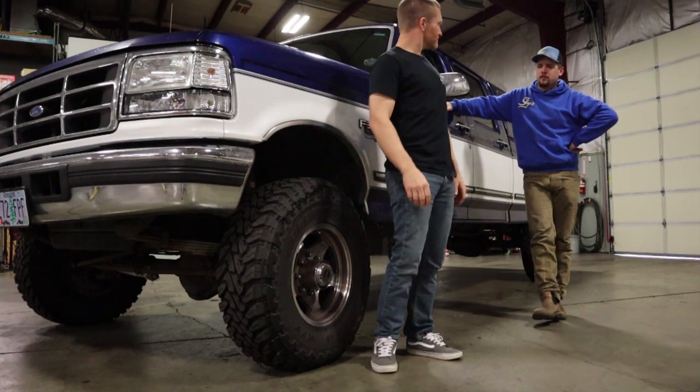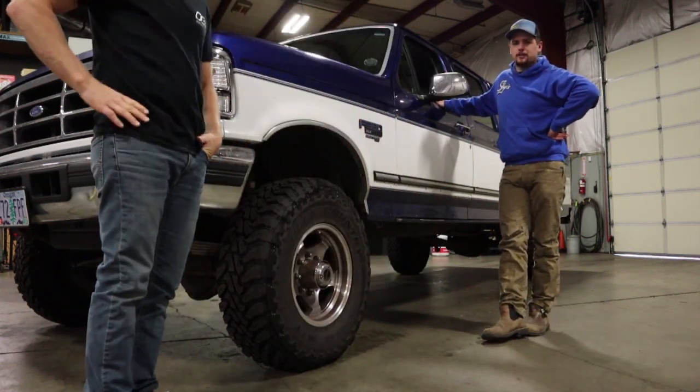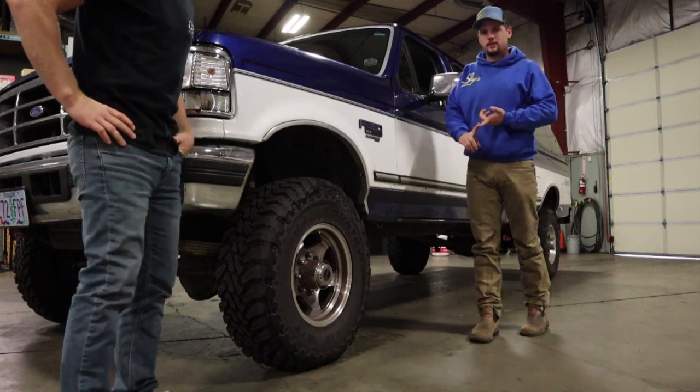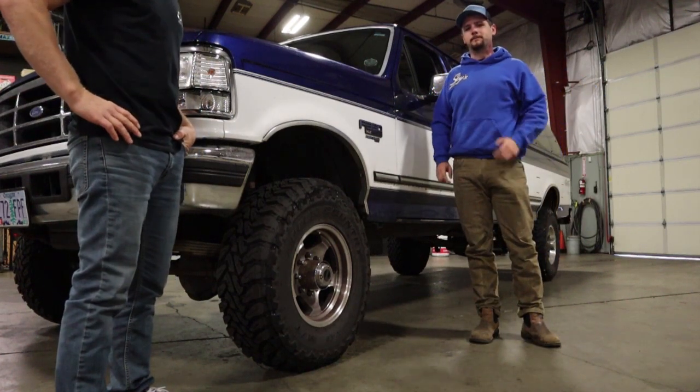Eric? Well, Devin gave me a call and said we wanted to lift this truck and correct some of the suspension geometry. So we're going to kill 3 birds with 1 stone. We're going to throw some crossover steering at it, crossover panhard kit, and those Super Duty springs.